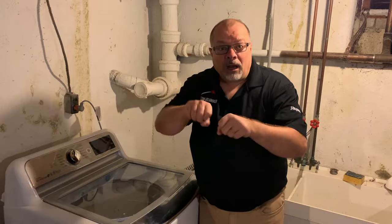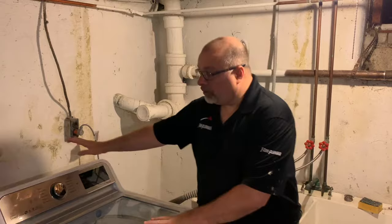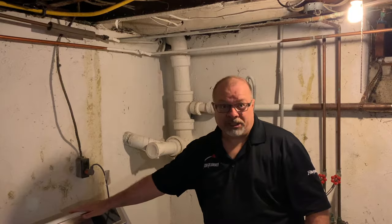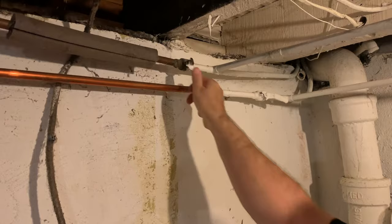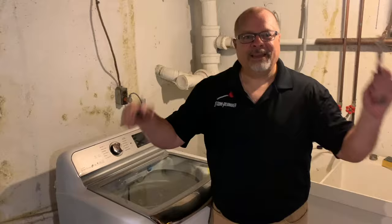So what we're going to do today is show you how to unhook the hose coupling, get to that inlet screen, and basically clean it. Step number one: you want to shut off your washing machine, which is already done here. Step number two: you want to turn off the water — the hot and cold water supply pipes going into the hoses into the machine — because when you remove the hoses you don't want that water coming out. Easy way is if you have one of these gate levers, you literally just turn it like this. These are the cold and hot water pipes; they'll be nearest your washing machine so you won't have to go looking all around the house to find them.